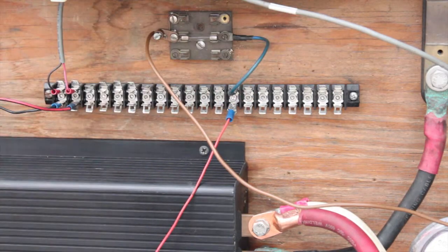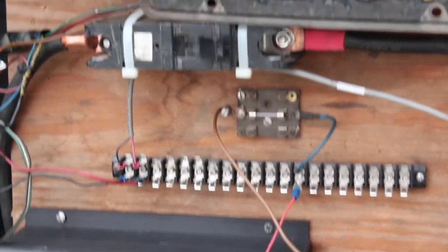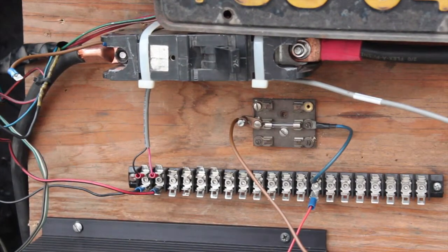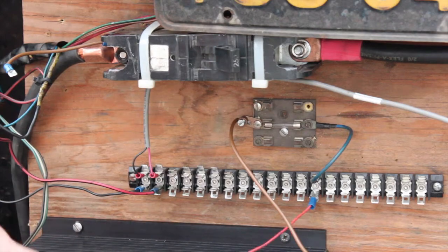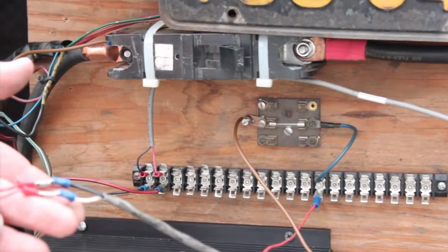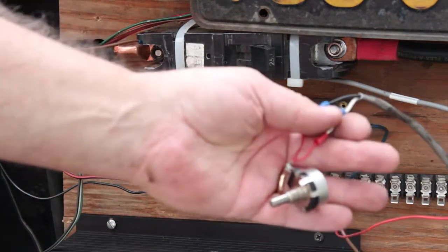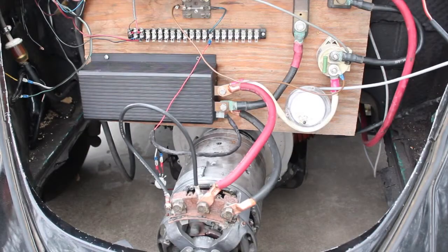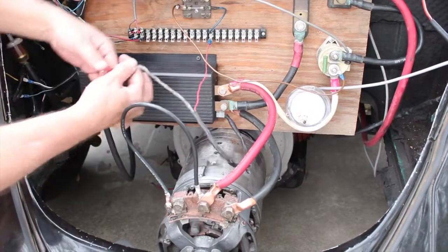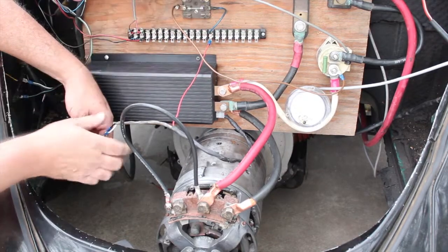This right here is 12-volt auxiliary, and I use this for my contactor which is right there. It's a very basic setup. I do have a large circuit breaker strapped to the board just above. For testing purposes, I have a throttle pot — wanted to show that. Put the circuit breaker on.